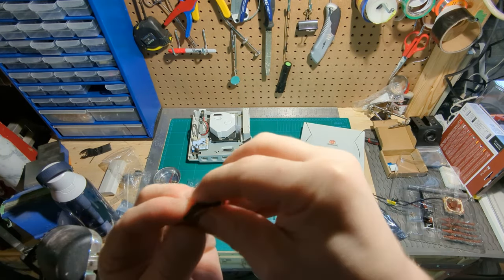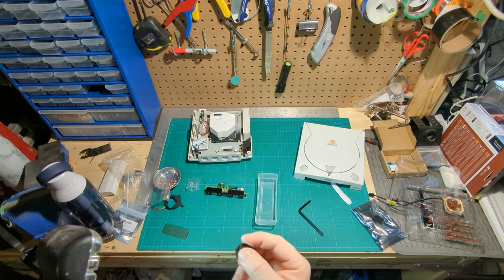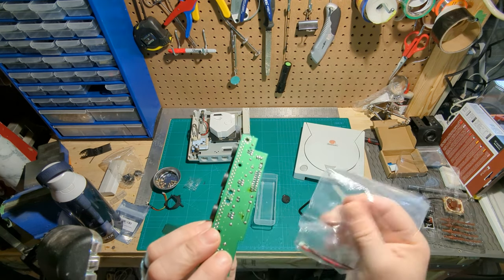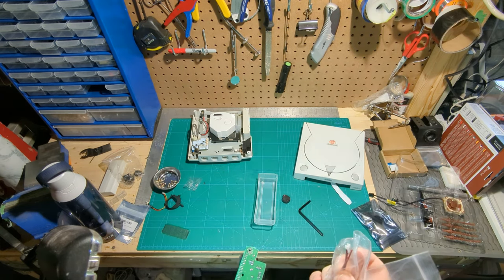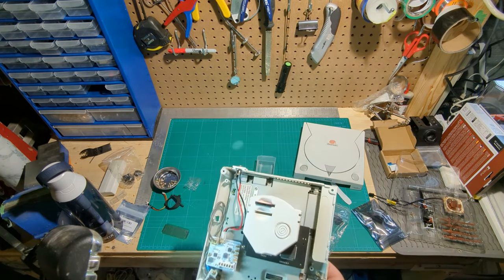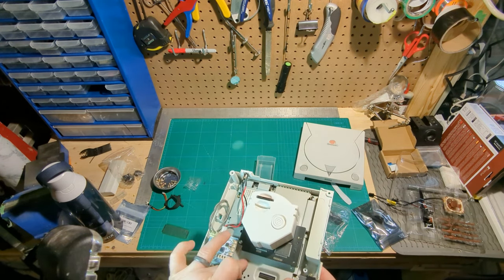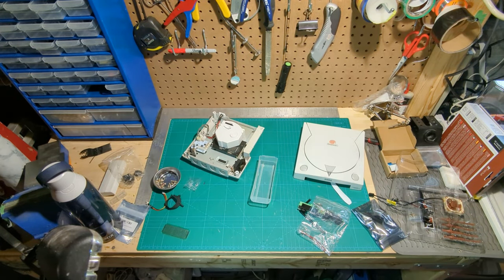So I want this battery holder that I'm going to connect to the pins on here. I'm going to use a little wire with a connector to be able to plug and unplug it, and maybe mount this somewhere on the body of the case just outside. There seems to be a little bit of space here, and I can insulate it against that metal backing plate. I think that'll work and shouldn't be too hard.